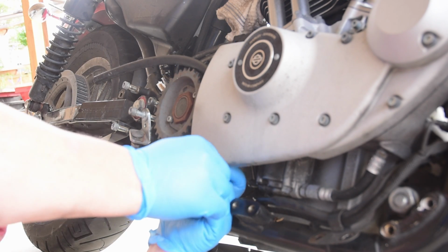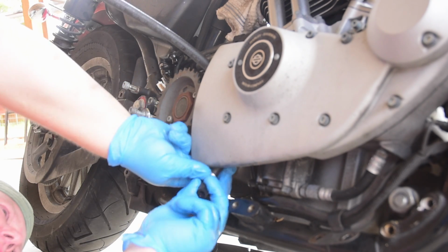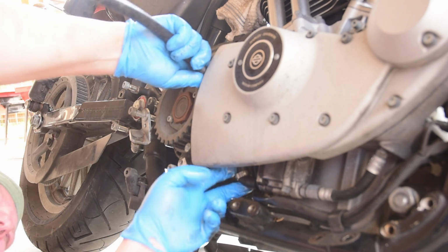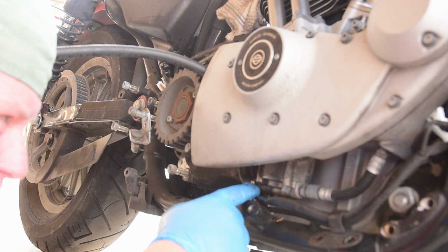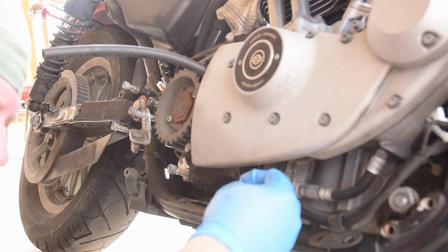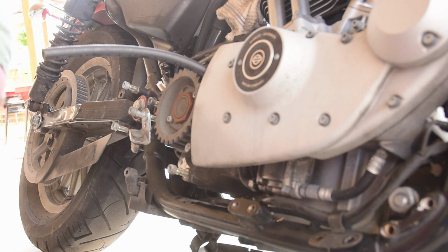Slide on our first expensive hose clamp, and then somehow force the hose onto the... And you want to make sure it is fully seated. That is very, very important. Then you want to position that clamp not at the very end, but closer to where the metal flange kind of bulges out, so it will sink down like that. Then that goes on the flat, and you just kind of squeeze it together.